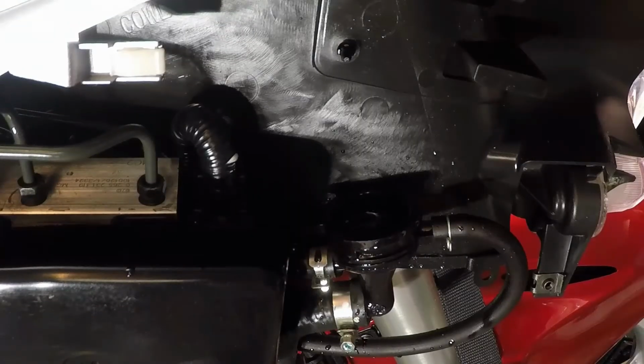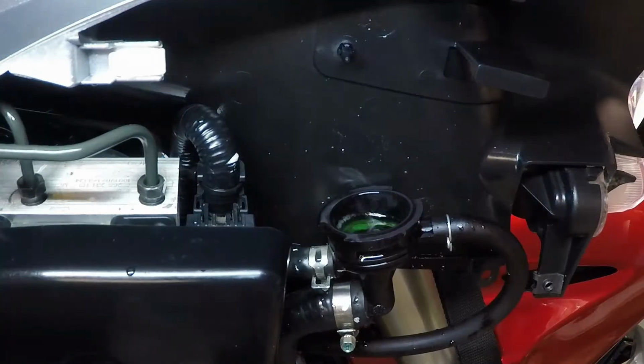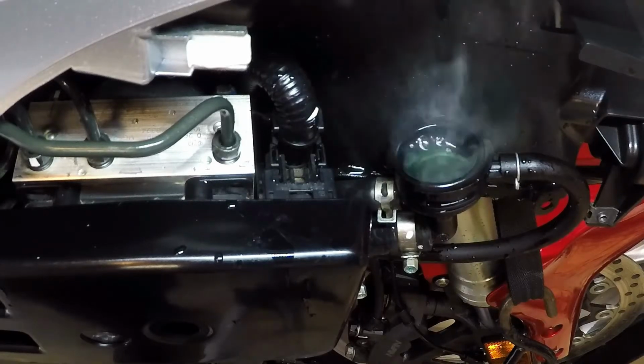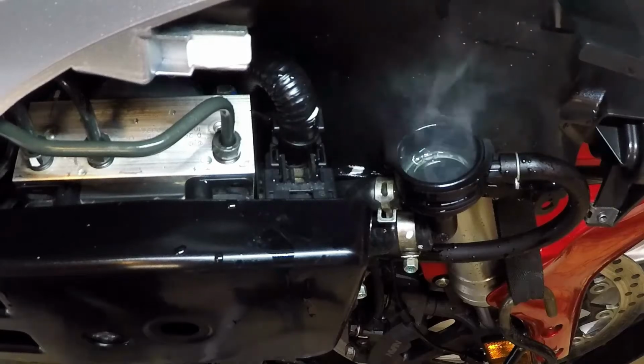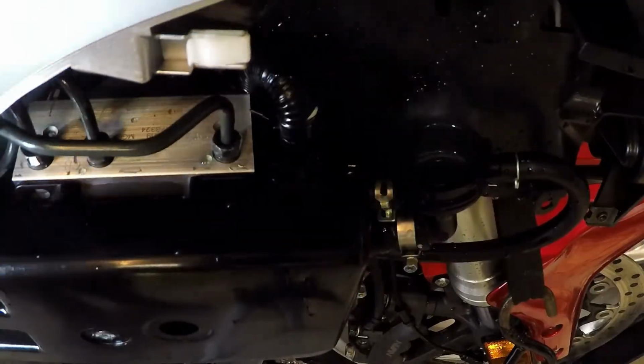Now comes the real messy part. You have to heat up the engine so that the thermostat in the system opens and releases the air pockets. When it does this, you'll see coolant drop in the radiator. Be sure to top up the radiator with coolant. A common mistake is to not properly warm up and circulate the system.